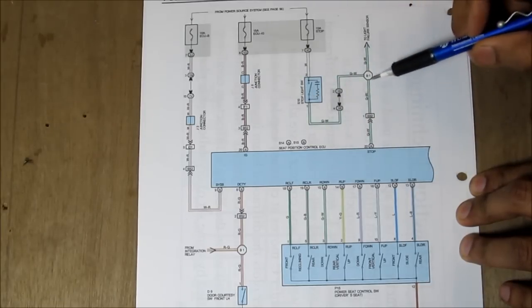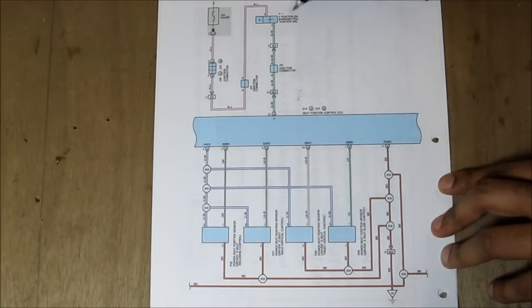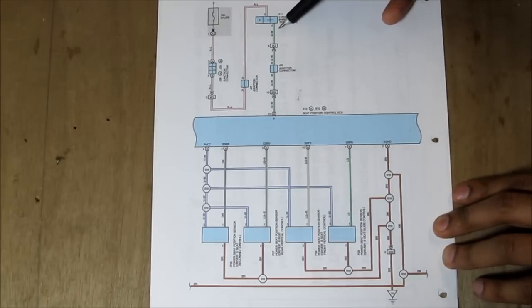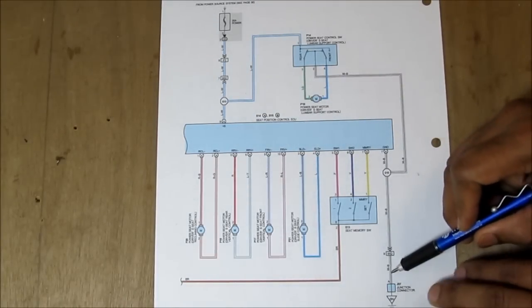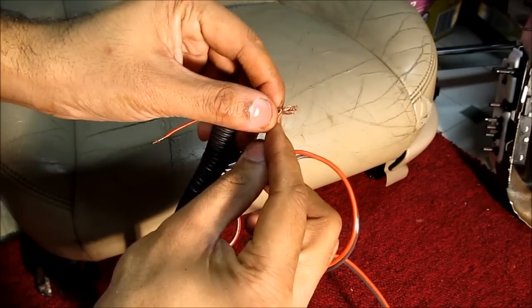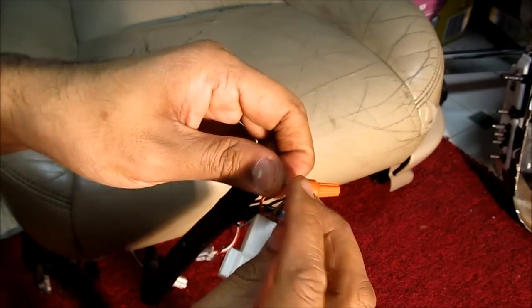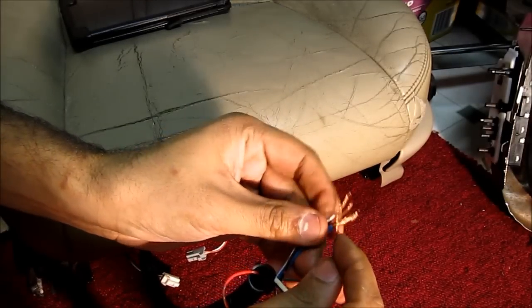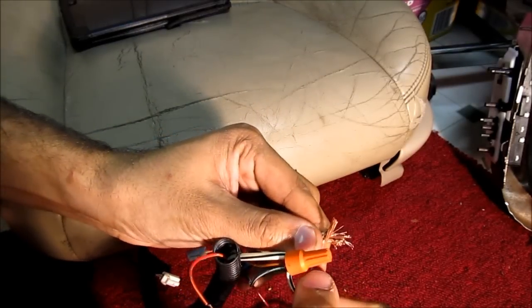Then there's the green and white wire that goes to the stoplight switch and the taillight failure sensor — that also needs to be grounded. On the second page there's a green and white wire that goes to the park neutral switch, which tells the seat that the car is in park so it can operate the memory functions, and that goes to a switched 10-amp fuse. I'm going to ignore this and wire it to 12 volts. Down at the bottom there's a brown wire that goes to ground. On the last page there's a blue and white wire and a black and white wire — that's your 12 volts and ground respectively. The white wire and brown wire are your ground, and the green wire from the stoplight switch also needs to be grounded, so I'm going to tie those together. Next I'm going to tie the red and yellow wires together — that's your seatbelt light wire. The blue wire is power. The two wires with red stripes come from the ECU and also get power. The green wire from the park neutral sensor tells the seat the car is in park so it can operate the memory function, so I'm going to tie all of that to the blue power wire on my car.